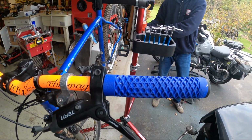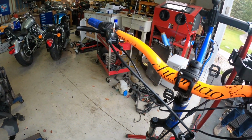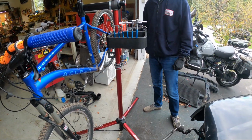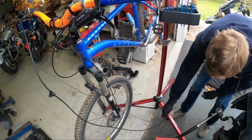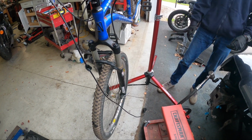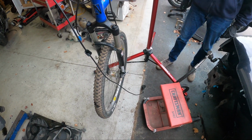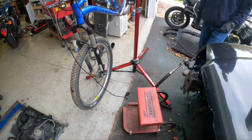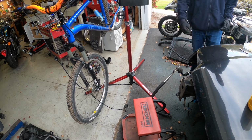The brakes already have a bleed port, just like a car, and you just screw a miniature reservoir on the front. We're using an adapter kit because this bike is a Frankenstein. So we're also gonna bring this down here, and then push fluid up to the top. I found this works basically on the first go, as opposed to like four or five times trying to get all the bubbles out of the kinks.